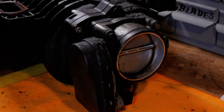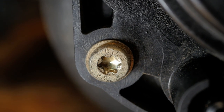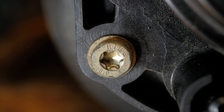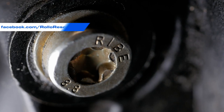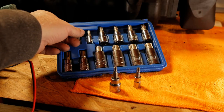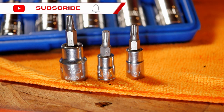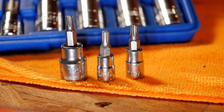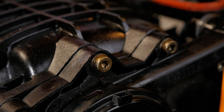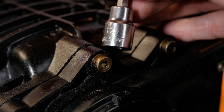As I mentioned in the intro, people often strip out the bolts that hold everything under the intake because they look a lot like Torx and Polydrive bolts, but they're not. Written on the outside of the bolt is RIBE 8.8, which might be pronounced 'Rib' depending on where you're from. They take a special set of bits that look a lot like a Torx bit but have wider, squared-off ribs with an R designation — just like T for Torx.